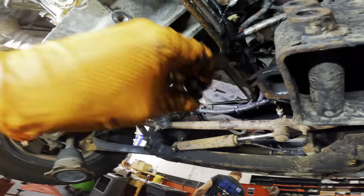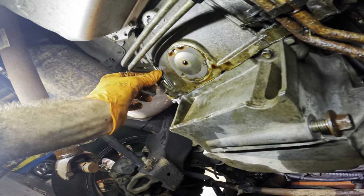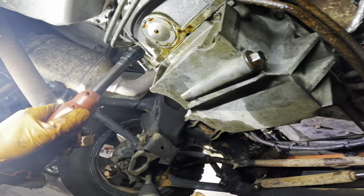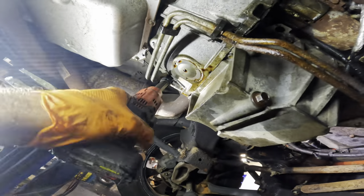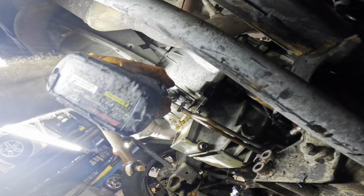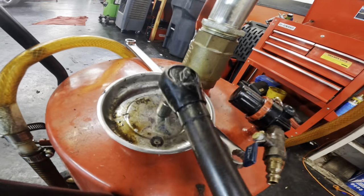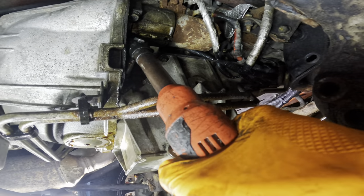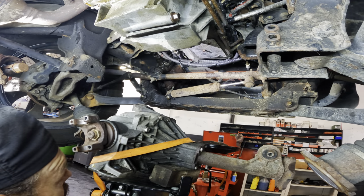Skipping ahead - some bolts are in, wiring harness is attached. Little plastic covers are covering. Drain plug and I've got two more of these bigger bolts here I need to run down. Then I can go put the axle back in. Before I do that I gotta check final torque on all the fasteners. And for everybody who says I missed a bolt, there's nothing left. That only seems to happen on GM oil pans for some reason. Regardless of the circumstances, I did a good job.